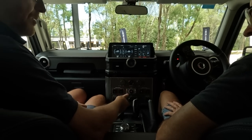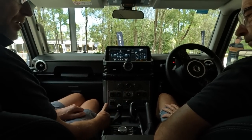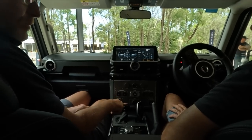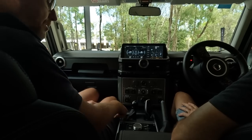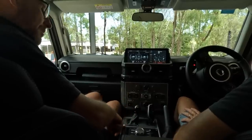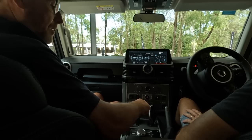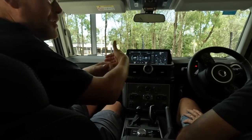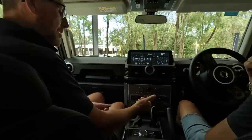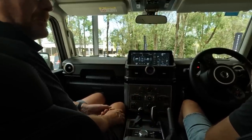So as you do the actual transmission, you lift this lever up, it will actually then bring it over into high range. It's a permanent four-wheel drive, but it's in high range open at that stage. High range lock is on this side. Low range lock is down on your corner here, locked and unlocked. The unlocked low is for things like reversing caravans or boat trailers in. It's a two-speed, so basically you end up with 16 gears.